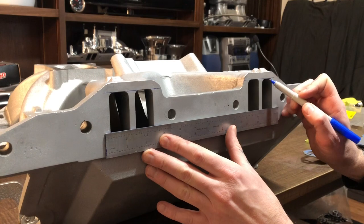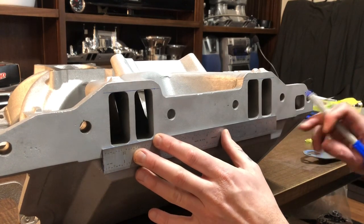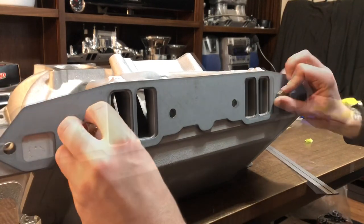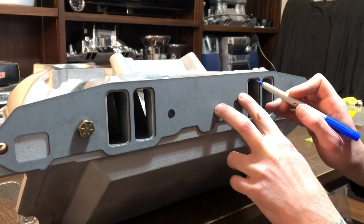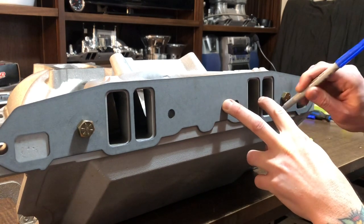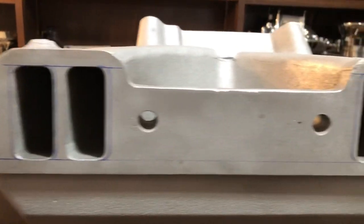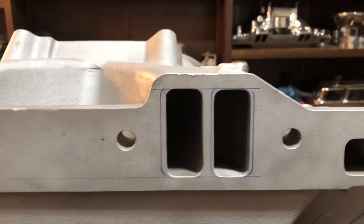It's slightly uneven so I might just touch that a little bit when I do the port. I'll mark the lines I'm going to work to. Now I can go ahead and press the gasket on with a couple of oversized bolts. Gasket is in position with nuts and bolts and I can just transfer this line — you can see the gasket showing above. Pull that gasket off and see what we got. There's a ton of material to be taken out here — about an eighth of an inch right in there. They weren't perfectly centered, so we'll center them up, widen them, and make some more horsepower.